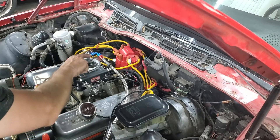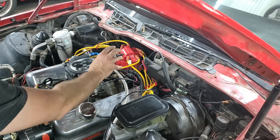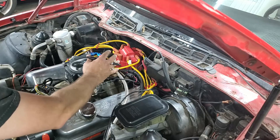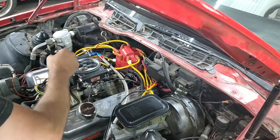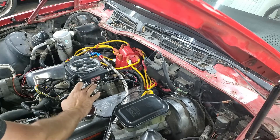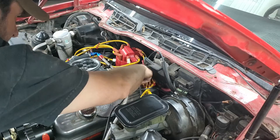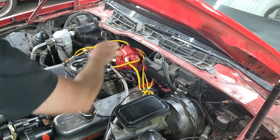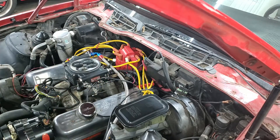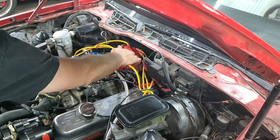So now we're here and we want to go ahead and remove the plug wires and the distributor cap. Some cars have a smaller distributor cap and you can actually take it off and install a new one without taking the wires off — that comes in handy because you can pull one off and put it on in the correct order. This one's kind of big so it's kind of hard to get in and out of the way. So what I do is I'll find the number one spark plug — I know that it's right here — and I'll put a mark right there on it so that way when I get it off, I know that's where I want to start with redoing my spark plug wires.